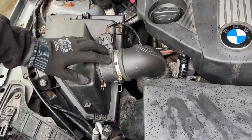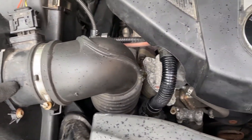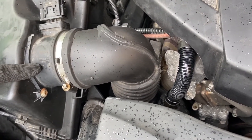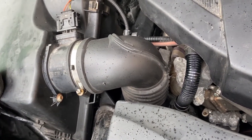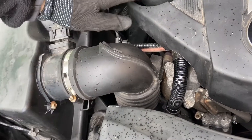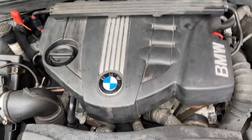When air passes through this filter it goes to the mass airflow meter — this one's made by Bosch. The part number is there if you ever need to replace it, and it's quite an easy DIY job. This will relay information to the engine ECU about the air and allows it to flow into the engine. The pipe connected from the mass airflow has a bit of flex in it, which allows the engine to move, stops anything cracking, and keeps things quiet and solid.